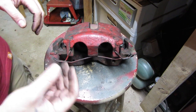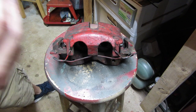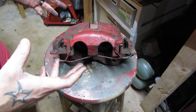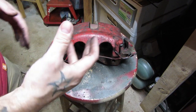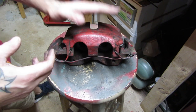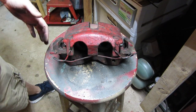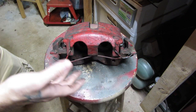I have a great video on death wobble — card up in the corner if you want to check it out. People ask me all the time, 'my death wobble happens every time I hit the brakes.' I say, you probably have a warped rotor. That little bit of wobble when you hit the brakes can trigger death wobble. So all these things — the clip coming off, excessive heat, warped rotors — they come together to make this just not a good caliper for a Jeep. It can't handle what we put our Jeeps through, and it plays into the other inherent Jeep issue: death wobble. Solid front axle, death wobble is possible.